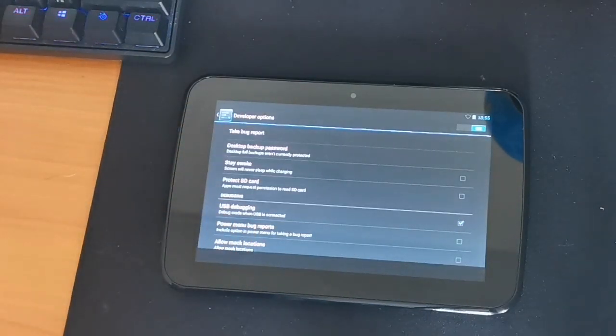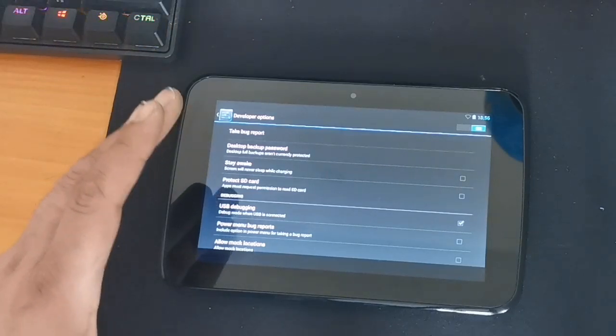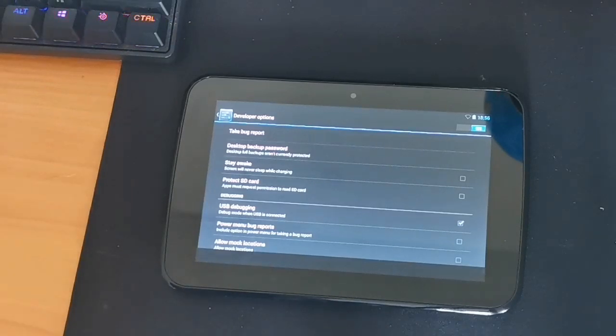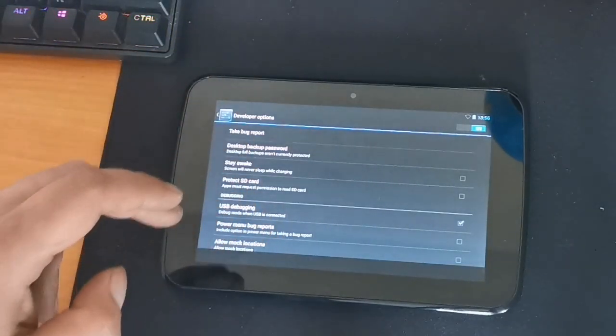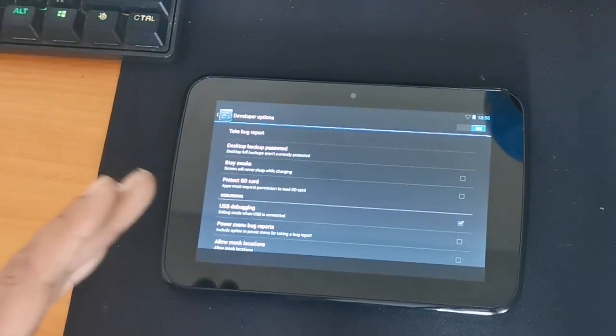That's as far as I've got at the moment, but the theory is simple. What we'll then do is connect this to a computer and using ADB and Fastboot we will try to push an update from the computer onto the tablet this way. Now as I said I've not got that far yet, but what we're actually going to have to do is physically put on a blank version of either 4.2.2 or Android 5.